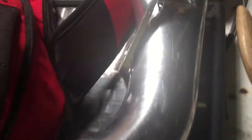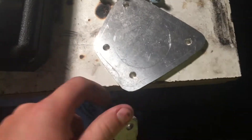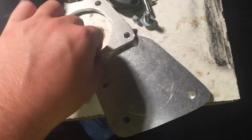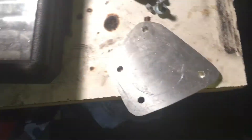Just got back from school to do a little more work on the inlet tube — it's been two steps forward, one step back. I remade the plate slightly larger since it was getting pretty thin in some areas — I traced the original with a scribe and made it larger. I haven't done the big hole yet because it's an oval shape, so I need to orientate it and scribe it out. I also cut two slits in the side so this can fit perfectly over.